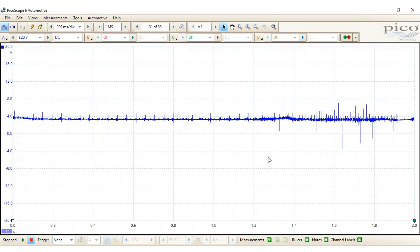As you can see on the scope, we've got the range up here. We did take a plus or minus 20 — you might want to go back in and reduce this voltage just so that you can get a bit of a clearer trace. AF sensors and oxygen sensors tend to be notoriously noisy, so we can do something called filtering.